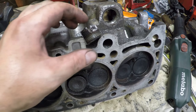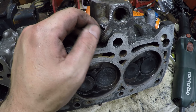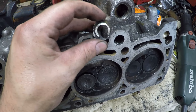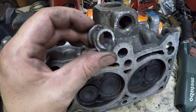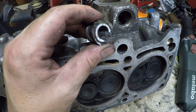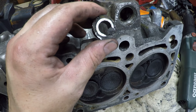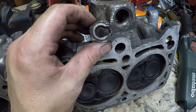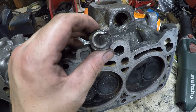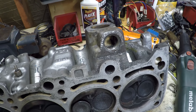I doubt it'll come up on camera, but you can see pretty clearly there is no deformation of the threads, at least where I wasn't using the chisel or the pipe wrench. It looks terrible, but if you look in there, you can kind of see where I just started to cut through the valley of the threads. When you see that, you know you're really close — that's when you can pinch it off, cause it to become oblong, and drive it into the center of the bore. It'll come out pretty easily. There's no damage to the threads in the head whatsoever. I'm surprised how good it looks. We'll be able to get this thing all cleaned up.